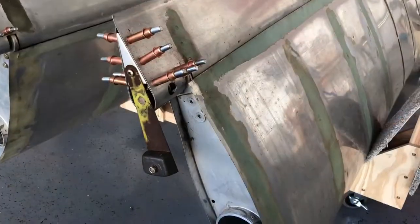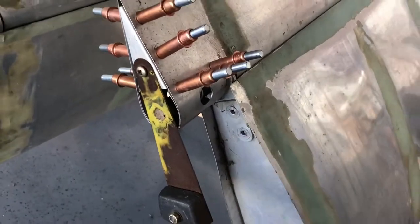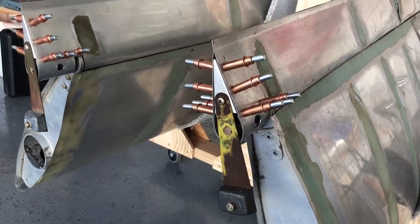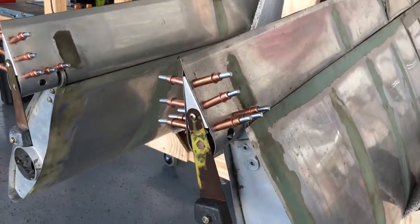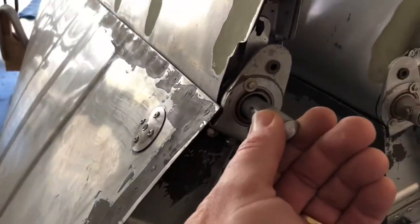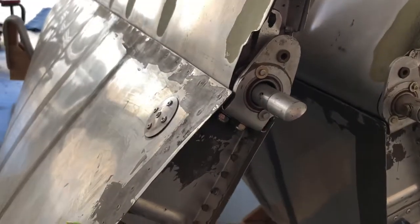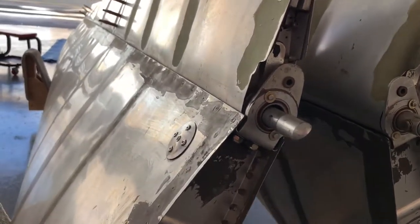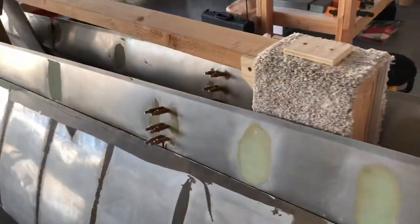BD5 pilot here at the Hillsborough hangar on a Sunday afternoon doing some work on the wings. I've removed the bolts that hold the bracket for one of the bushings for the aileron at the outboard edge, and then another bolt that holds the torque tube that drives that aileron. Now I'm going to pull that through and get access.